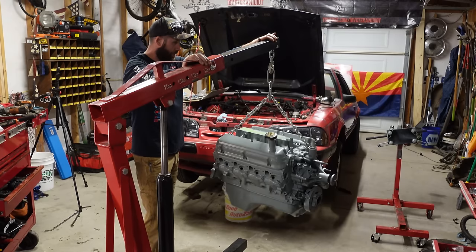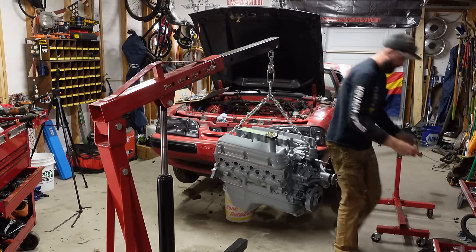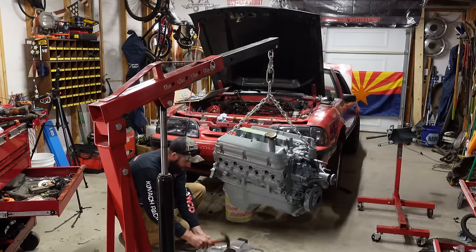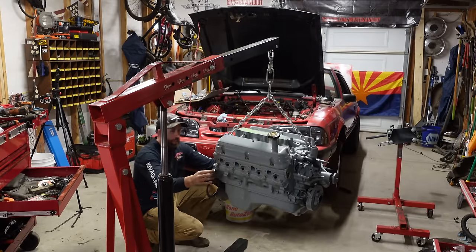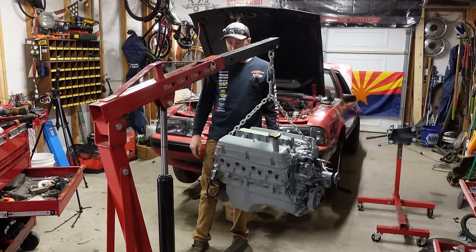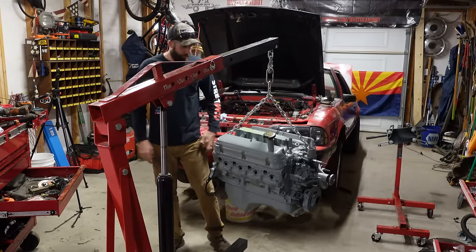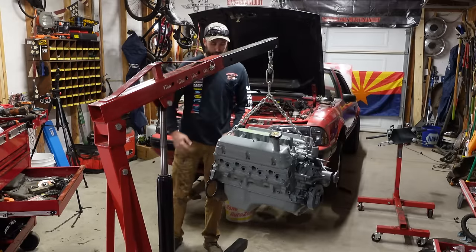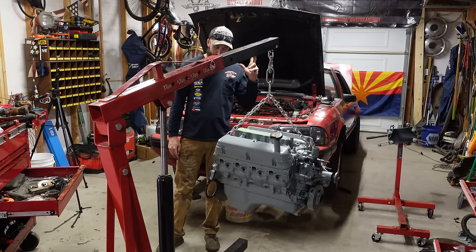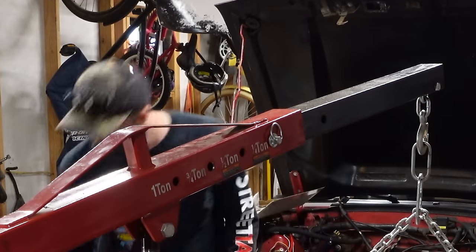Slap this dust cover on, and then we can get our new flex plate in that business up there. It's got a little ding in her, kind of straighten her out first. Last thing you want is this cover pinging around behind the flywheel. If you ever had that happen, you know exactly what I'm talking about and why it's the worst thing on the face of the planet, especially when you got a new build engine and you're listening for knocks and the flywheel's going bing, bing, bing.